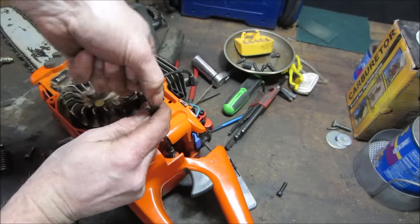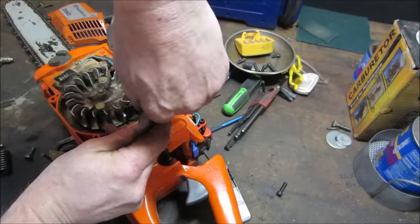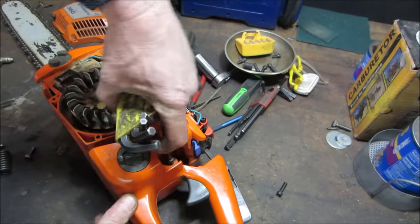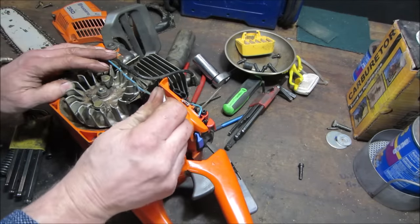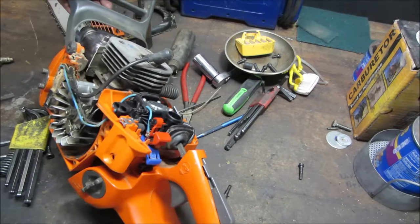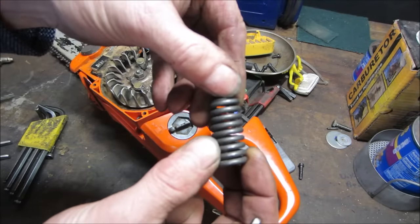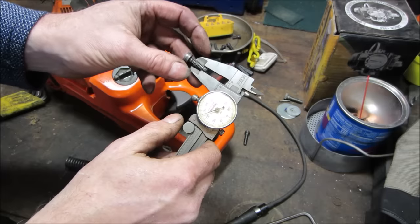I might be able to get it with one of those. Let it cut some new threads. Bottom out, and then we'll measure off of that how much is left, and we'll know how long of a screw to put in there. And then from there, we can cut one just so it'll have full length, so we'll get the most bite. I think that's it right there. So I'm going to eyeball down the side of that. I'm going to count how many threads are there and reduce that from the screw, minus whatever it takes for that seating. We probably could leave another one or two threads for the depth of that last spring that's on there. Go measure that up. 235-ish.